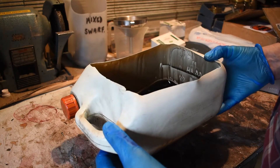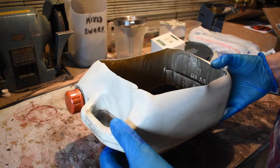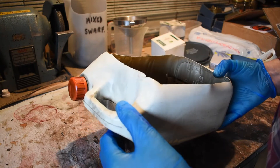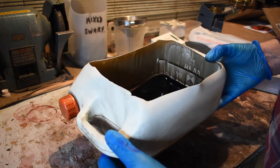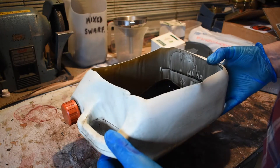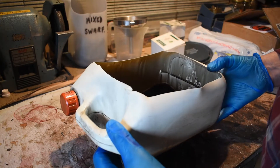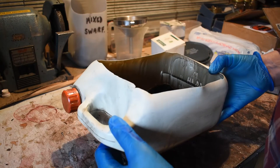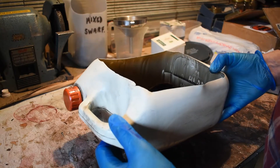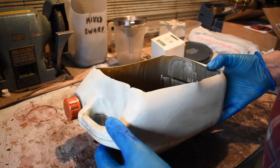The other thing I'm looking for is the texture and colour of the oil. It's a nice black colour because it's been burnt inside the engine, but there are no sparkling bits in it — no bits of metal. I've seen it on a gearbox oil where you get a sheen of gold coloured specks, which is where some of the insides of the gearbox is wearing out. But this is nice and clean.